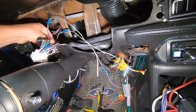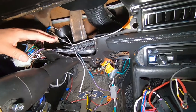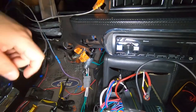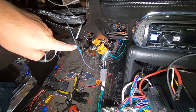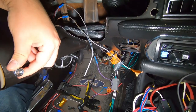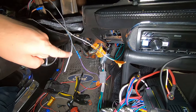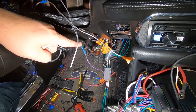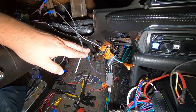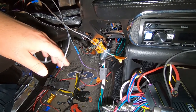I can probably get rid of some of these wires and cap them off. What I need to do is convert all of the switched outputs from sending positive to the lights through a blinker module, to grounds that will be used as a trigger for the PMU. So when you pop the hazard switch, that will ground out on the output going to the PMU, and the PMU will see that circuit is grounded and triggered, then send power to the lights — serving as a relay and fuse for each light circuit. That way, if one circuit has a problem, you only lose that light rather than all of them.